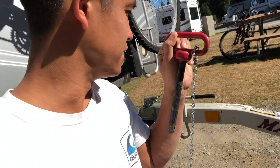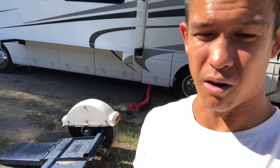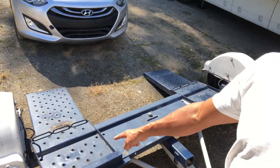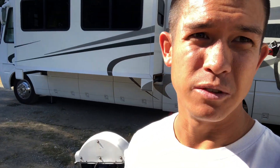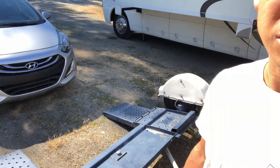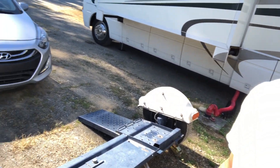I'd be lying if I said I had never driven off without replacing the ramp pin, so I like to put it right here just in case — if I drive off, I still have it. Before loading the car, this piece right here is the only moving piece on the dolly, so I like to make sure it's somewhat straight. Just kick it into place — it doesn't have to be perfect, just so the wheels hit it at roughly the same time.